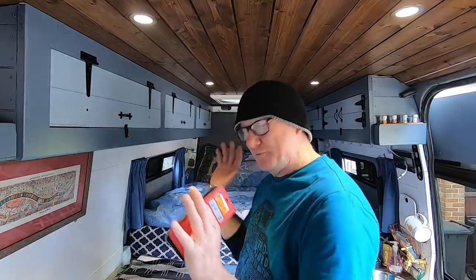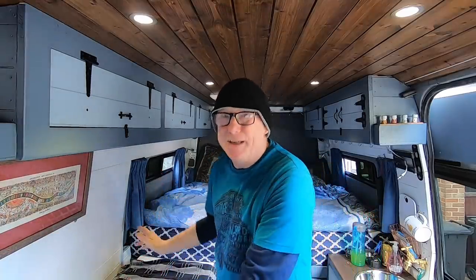Amber Outdoor Smith has asked: is it OK to glue the battens to the side of the van? Personally I wouldn't glue the battens to the van - I would screw them as well as glue them if you really want to use glue, because the van vibrates so much when you're driving that the best glue in the world could easily fail under those conditions. Once you've put your battens on the wall, then you put your walls against the battens, then you're going to have cupboards and all sorts of things - it needs to be quite weight bearing. Once you've done your battens, put a vapour barrier over the top and then build the rest of your van.